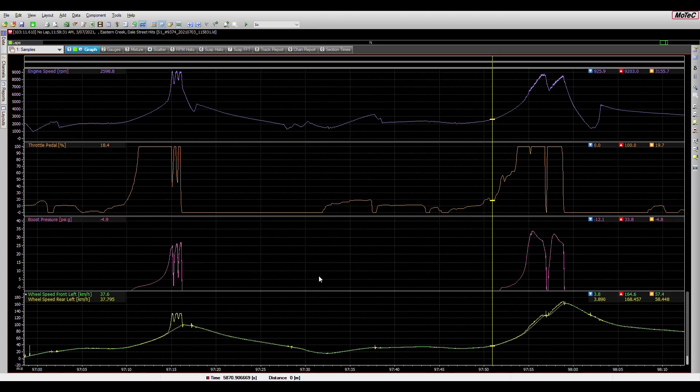So we're back from the drive. I've downloaded the log from the GTR and we can have a look through it — I'll show you exactly what the system is doing in terms of wheel speed. We can see how fast the rear wheels were going, how fast the front wheels were going, and what was actually happening inside the car. The first hit I'm going to demonstrate was the second-gear roll onto the throttle — the small amount of pedaling I was able to do. You can see I've put my foot flat on the floor, we're building boost, and as the car comes on boost we jump from around 5 pounds almost immediately to around 25 pounds.